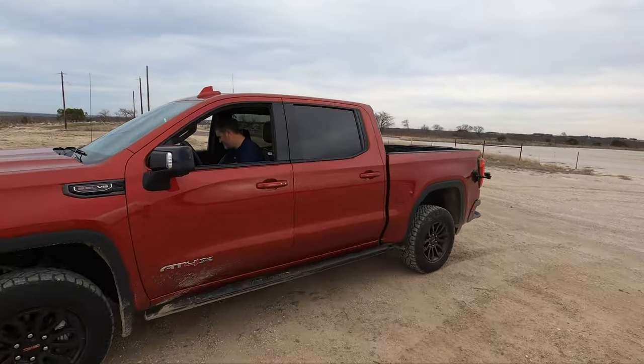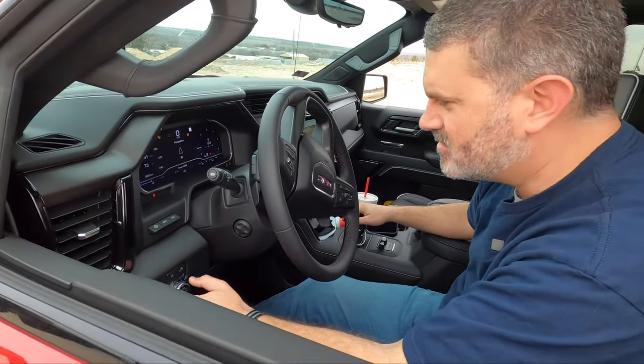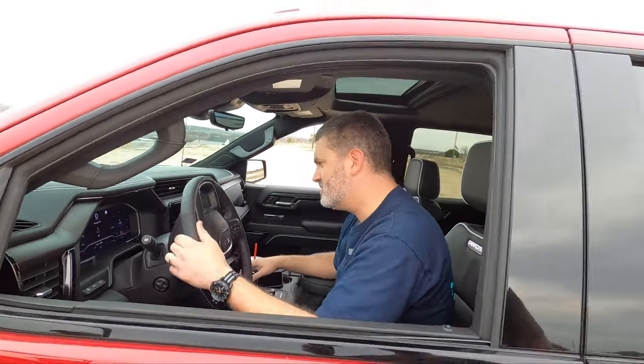Oh, well, hey, what's going on here? Well, I'm trying to unlock, but it's staying locked. Oh, wait, so the theory of an e-locker maybe not unlocking might be real? An air locker just pulls the pin. Yeah. I feel a little bit wrong all of a sudden. All right, coast it back and forth and just rock it out. Yeah, I think we're going to go to four high. Oh, you're out now. I hear it. Okay, but if you're on a trail and you're stuck on a hairpin turn, you may not have enough feet to roll and unlock it.